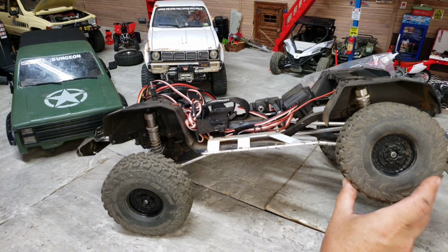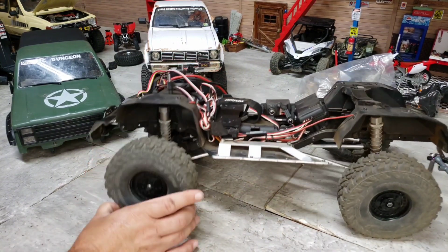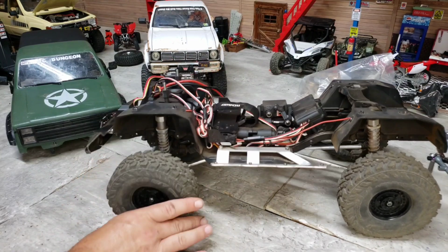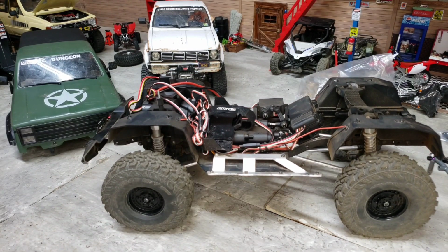how the design works. But going forward, you don't get this lift that a lot of models get. These don't do it because of how they design that anti-torque twist setup inside the transmission. It's called a torque twist reduction transmission, is what they call it. And we went over the counterclockwise rotating drive shafts and whatnot.